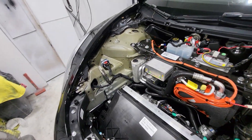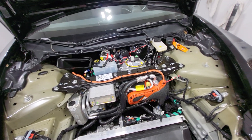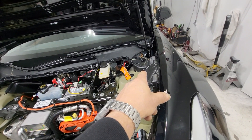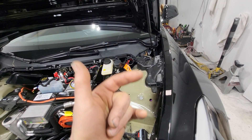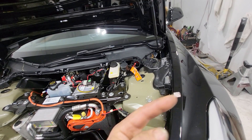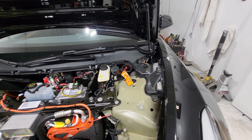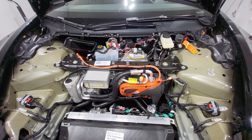There is no longer a grommet on the 2023 over here, so the firewall isn't as easy to access. There is a rubber boot down here on this car with wires on it — if you take all that stuff off underneath the steering wheel you could poke a wire, coat hanger, or something through there and probably get your wires through. But if you can avoid that, that's what I suggest.